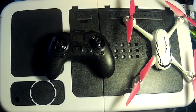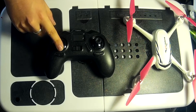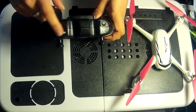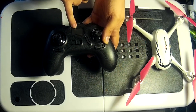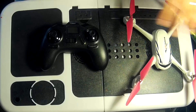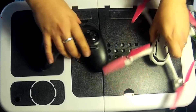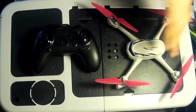You've got your standard trim buttons, throttle, and directional controls. There are also two shoulder buttons — one for photo and video, one for return to home. A single click takes a photo; click and hold records video, indicated on the screen. The return-to-home function uses satellites to estimate the takeoff point, since the controller doesn't have built-in GPS like the Phantoms. It'll work better than basic return-to-home but may still be a little imprecise.